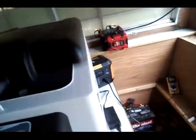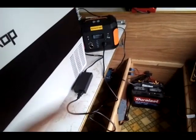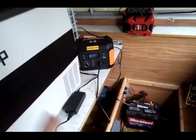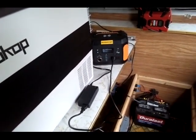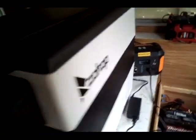It is starting to freeze up — much better than running it off the 12 volt. The ice is starting to freeze; the water looks good; the inside is starting to freeze up. So in 1 hour it says minus 1 — it's starting to freeze the ice. During my last test it was 5 to 6 hours to get to this point running off the 12-volt port. So in an hour off the 500-watt AC inverter it's already at minus 1 and freezing.